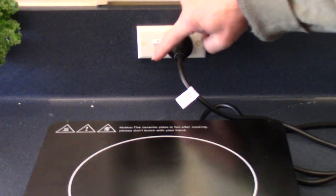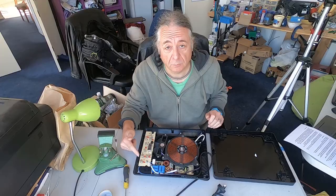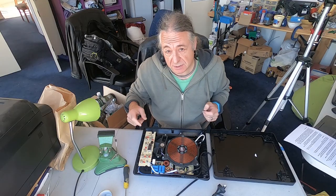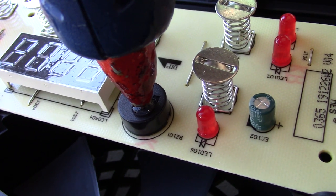Allow me to illustrate my point. I turn the thing on and it beeps, but I haven't actually turned it on — I actually have to push this button to power it up. And then I have to select whether I want temperature level or power level, and then I have to select the power level. And it beeps on its own because it hasn't got anything on top. This board here with all the switches and displays contains this little bugger, which is what makes all the noise. As none of these switches are a volume control or on-off switch, we will solve this problem simply by filling it with non-conductive hot glue.